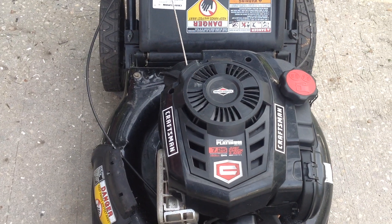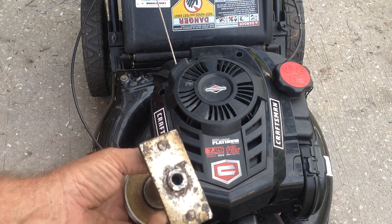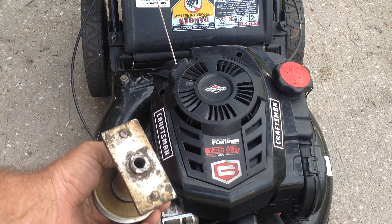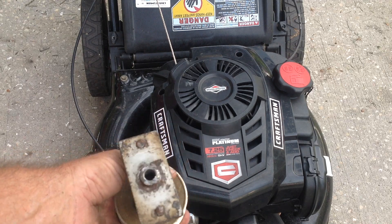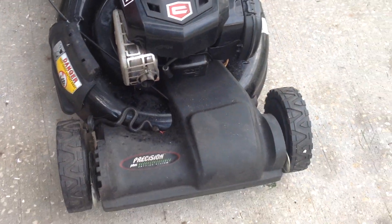That's all I've got for you. This one was a little different with the bad adapter — somebody must have run into something and spun the blade around. When it was running rough, I thought maybe it was the shear pin off-timing, but the plug was the real culprit. I thought I might have to disassemble all of this again and put another shear pin in it, but it seems to be running fine now. I'll deliver it and hopefully he's happy with this Precision Plus cutting system by Craftsman.